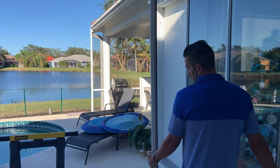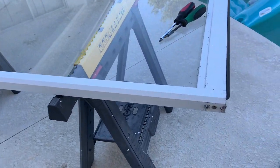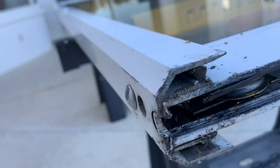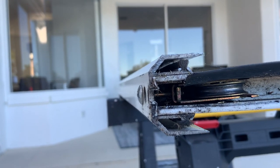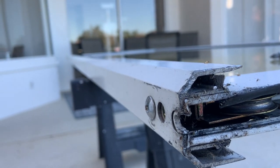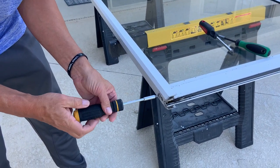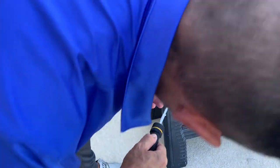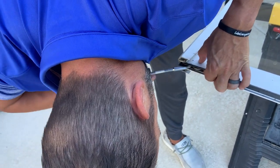Here's what it looks like with the door off. As you can see, there's a mounting screw right there. We're going to take that mounting screw out and then use the screwdriver to pop out that roller. That's what we're going to do and then replace it with a new roller. We're going to pop this out — sometimes you've got to finagle it a little bit.